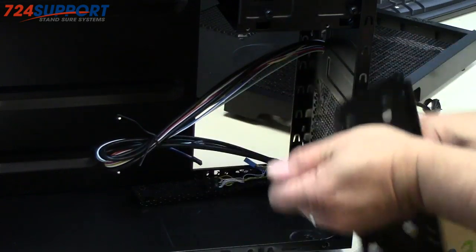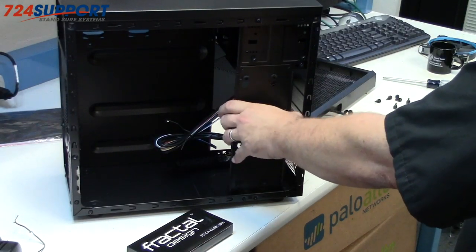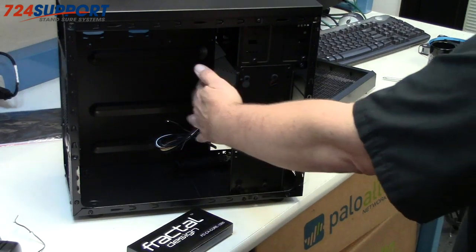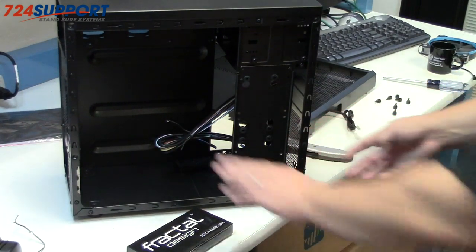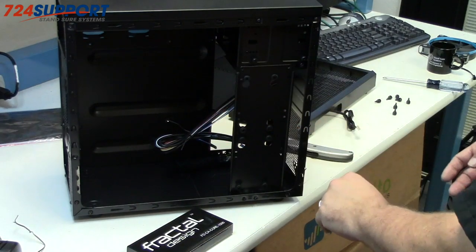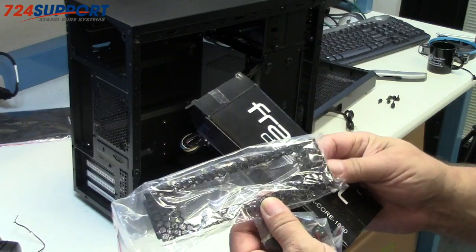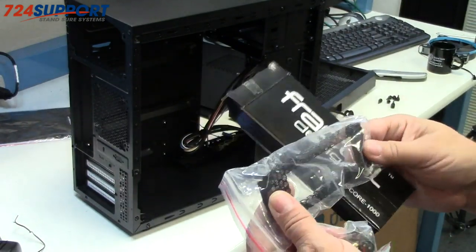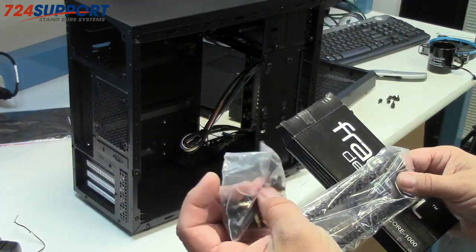So that's the design — you mount your hard drives back here. What is interesting about this design positively is that airflow is going to go straight through, so a couple of hard drives will pick up air. There's not a lot of exhaust, so you're going to end up with a positive pressure scenario: you have a 120mm fan here, a 92mm at the back, and possibly another 120mm coming in. The accessory kit contains another five-and-a-quarter bay cover, although it has a mandatory cutout for a three-and-a-half inch device — let's call that a fan controller — plus traditional screws, standoffs, and a speaker.